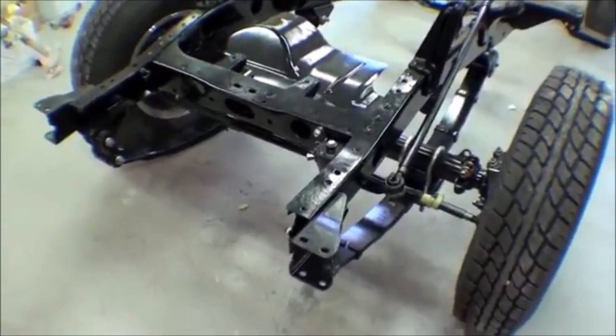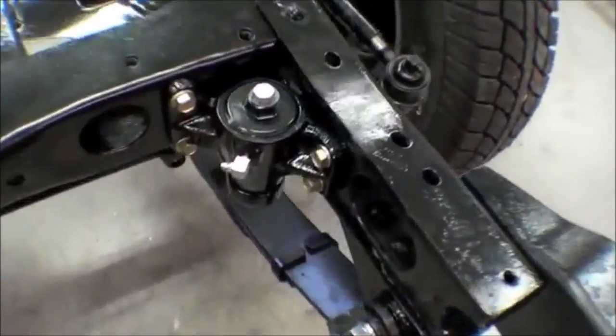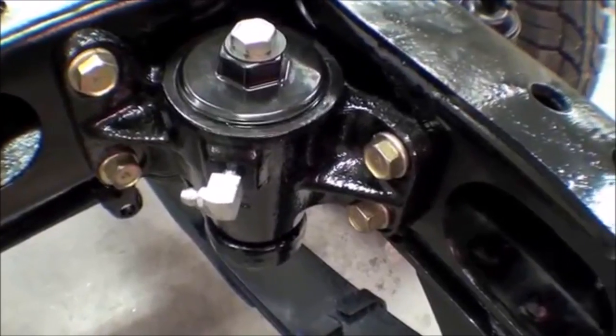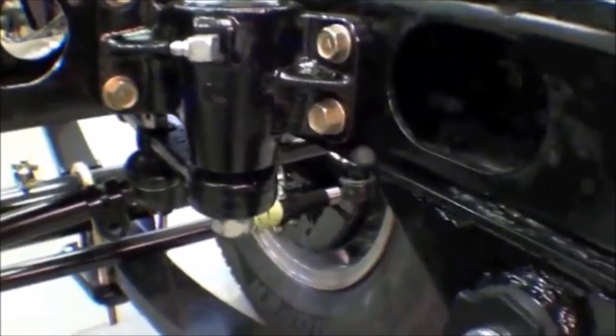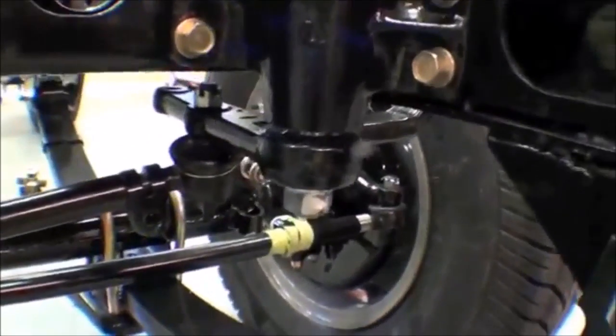All right, we pushed forward. One of the things that was installed here today was a center arm rebuild kit, and that is the primary steering for this. It's located on the outside of the frame here, and this center arm is basically a bushing up in here that drops down to a pitman arm down here.